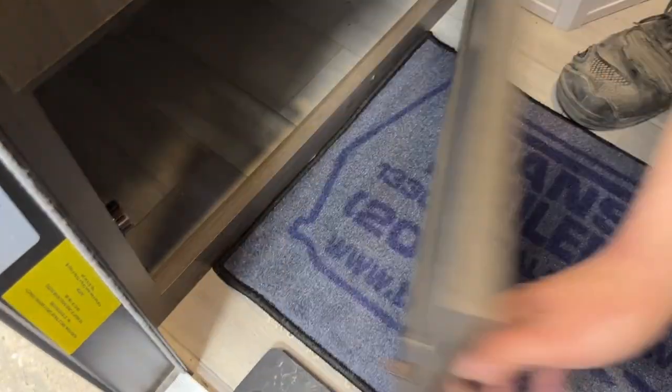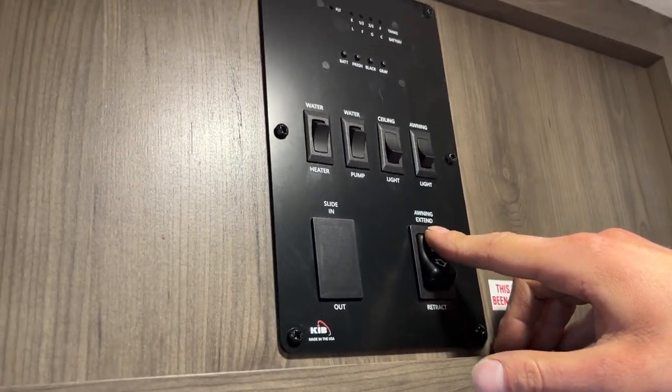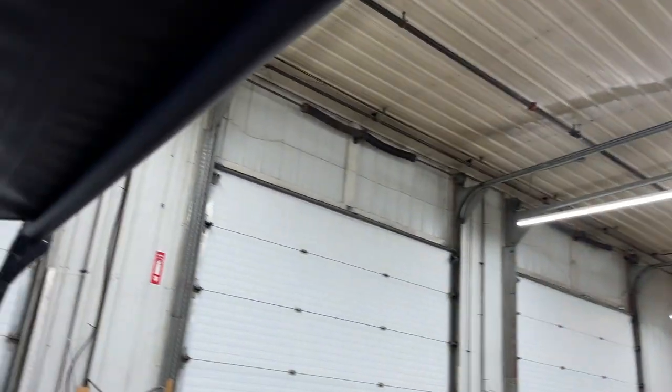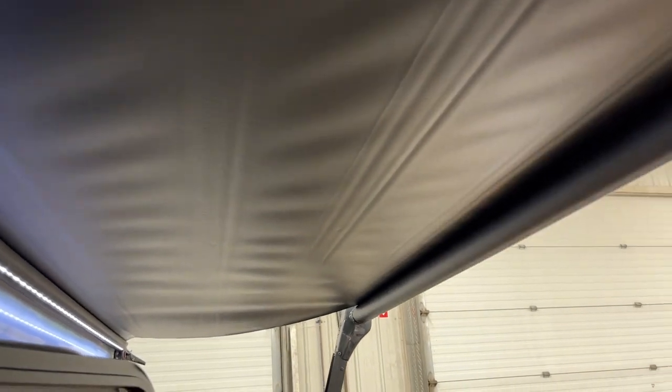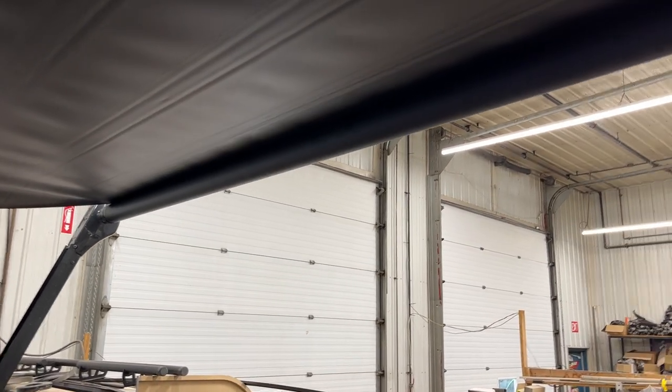There's closet space here as well as some shoe storage. For the awning, it's just this switch — press and hold Extend and the awning will make its way out. Once fully extended, you'll see a little black flap come down as well as the black metal tube. Once you see that, stop — if you continue extending, it can wind itself up backwards, causing the tube to hold water and accelerating mold growth.